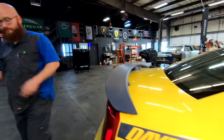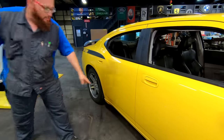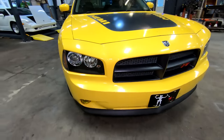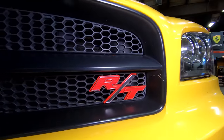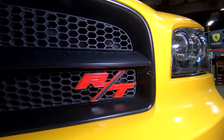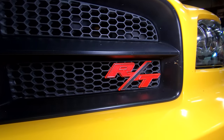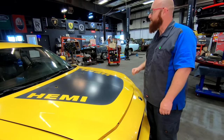Going down this side — really no serious damage or anything. I'll be putting the belt moldings back on. And one last thing on the front: if we go to the grill, you'll see if Mrs. Wizard approves of my handiwork. I took the badge off — the paint was all gone — and I actually painted it with the same crinkle paint that we use on Ferrari valve covers. Looks pretty good. I scraped the chrome edges off so it all looks like original. Now it really pops and it's crinkle finish. I've also cleaned the engine bay and replaced the hood latch release handle — it was broken, now it opens nice and easy.